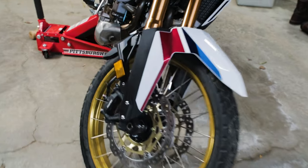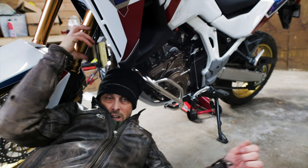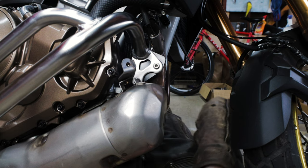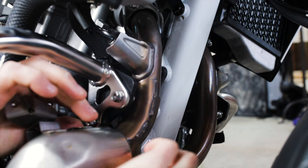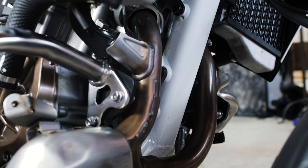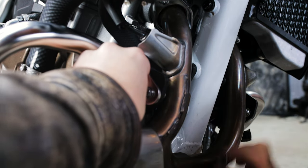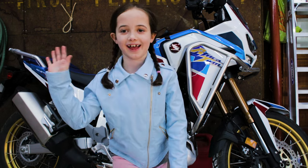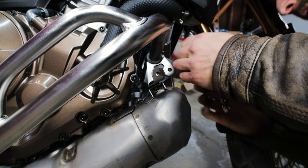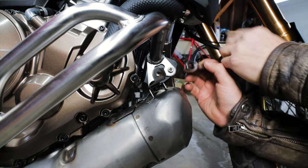Head over to the right side of the bike and insert the eight millimeter bolts into the middle and lower bolt holes. Again, if you plan on installing the upper crash bars, leave the middle bolt out — here is where you will attach the upper crash bars. Next, just like you did on the left side, attach the cap nuts on the other side of the mount. Loosely install the six millimeter bolt — this one attaches a bit differently than the left one; it threads directly into the rear where the bar meets rather than the bolt hole. Here's where you really need to fit your fingers in a tight spot. If you have someone with tiny fingers, bribe them with ice cream to put the six millimeter bolt in. I threaded the bolt in until it bit and then tightened it up with a 10 millimeter ratchet wrench, keeping all bolts loose until after the next step.